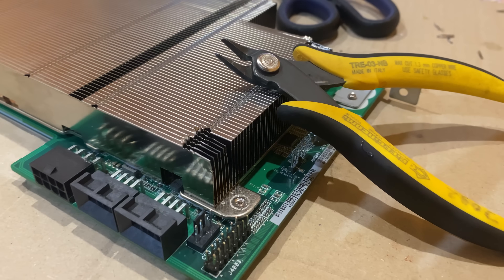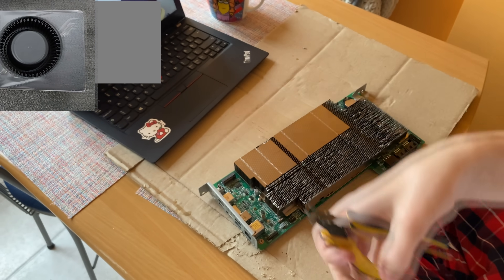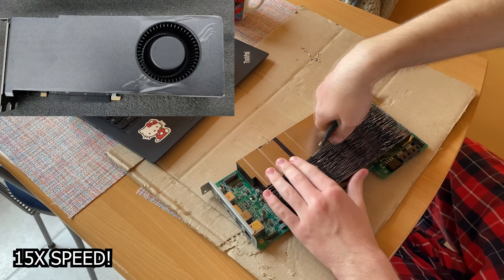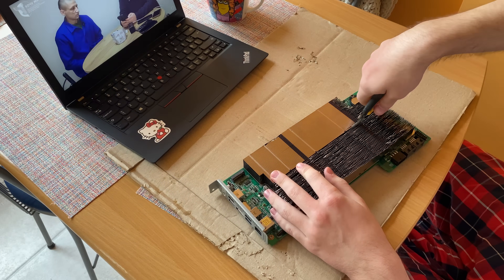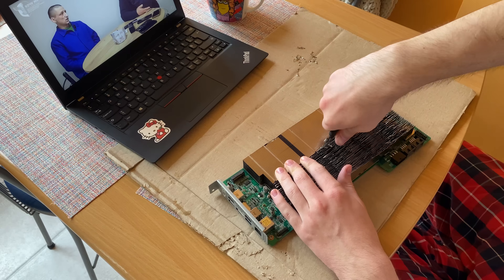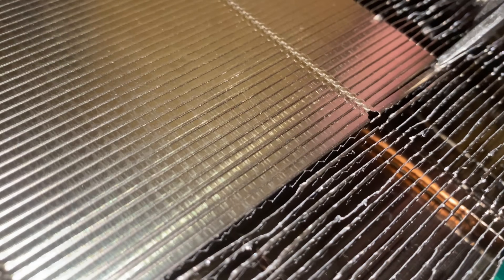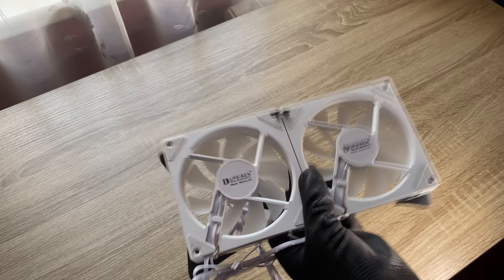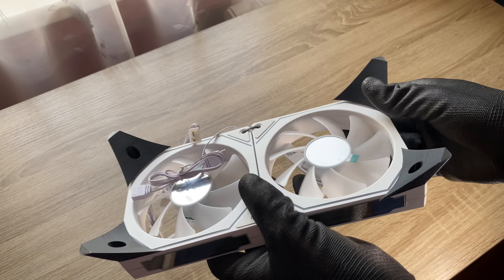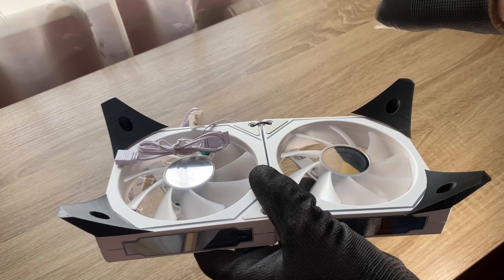So why did I make this thing so ugly? It's designed to run in servers, so the cooling is built for that. If you want quiet fans, you need to use 120mm ones, and if you don't remove the radiator ribs, the air will not go through properly. I spent hours doing this, and I hope you will use a better tool for it, since this modification is pretty much needed unless you want to cope with airplane sounds from the turbine. I also 3D printed legs, but putting two fans on top seems like a better option.